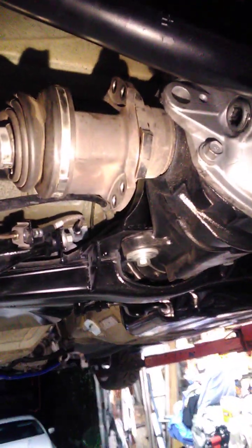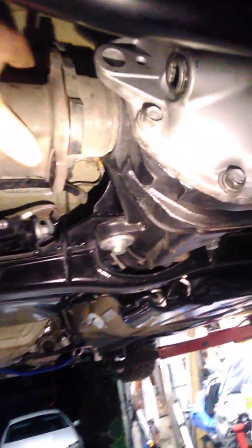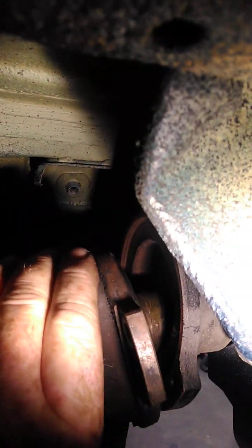Still not enough though — we need about 20mm lower on the rear. It was a little high. I'll pull it all out and take some photos. One thing I did notice whilst I was under here was we can't get the CV out in the car. With the diff in, the CV — no matter what you do — it won't come past the CV cup. So now I've got to drop the diff out just to get the CVs out.